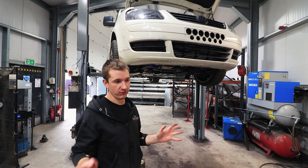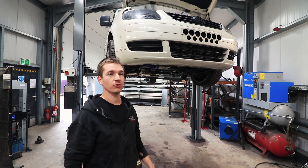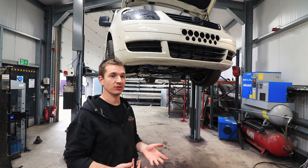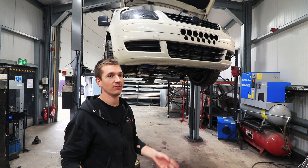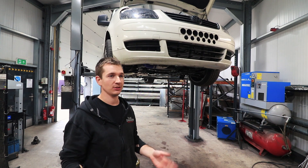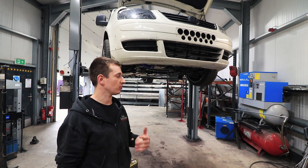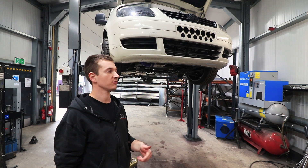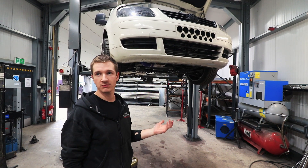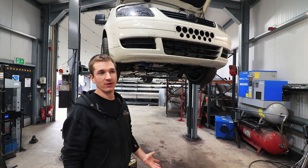The reason we didn't do a full run is because it's always good to put the oil filter out, have a look at it and change the oil, because there's going to be some little bits of crap in there — no matter how clean you are, you're going to get some rubbish in there. You want to check that you've not got any ring scuff, so you'd see some Teflon from the side of pistons, or start seeing some bearing material, or any steel or iron.